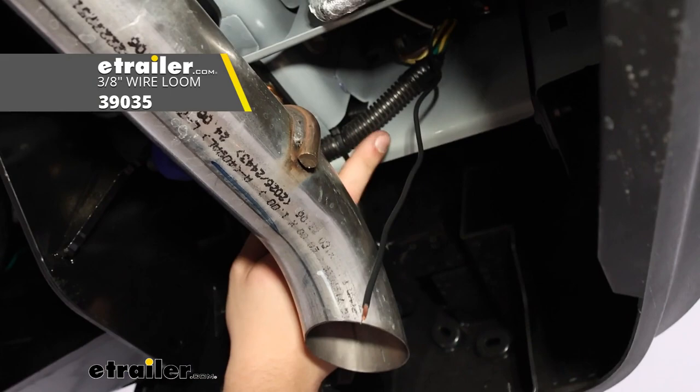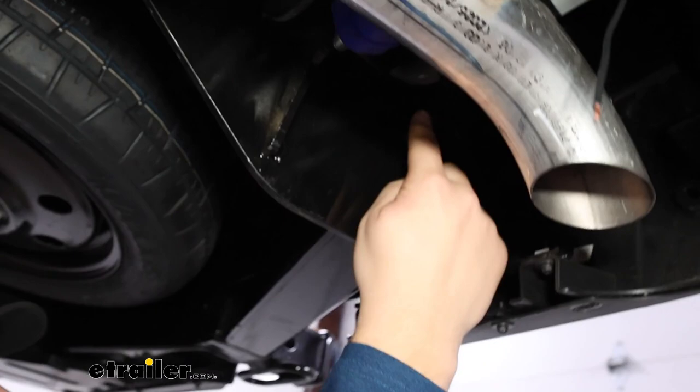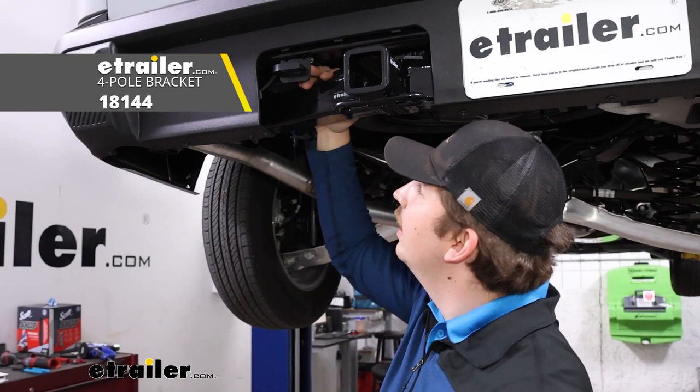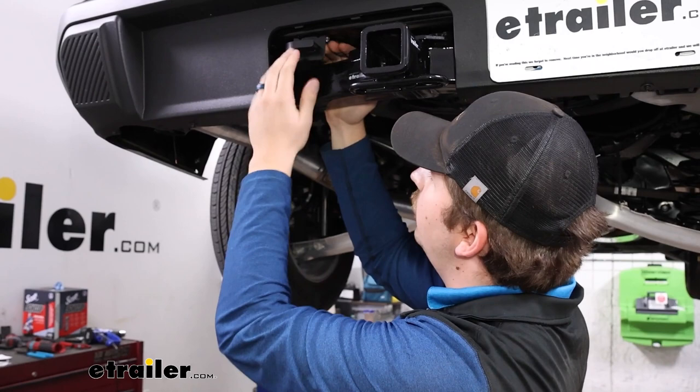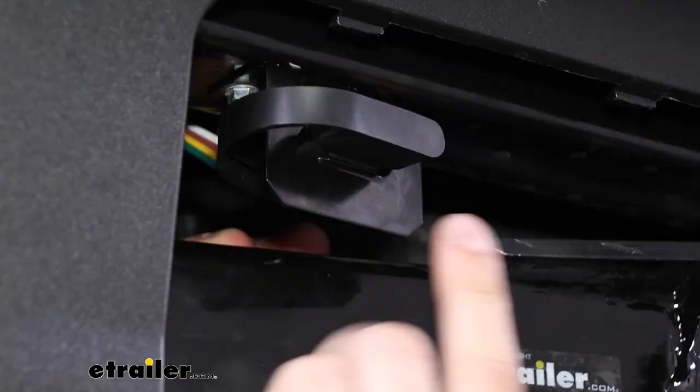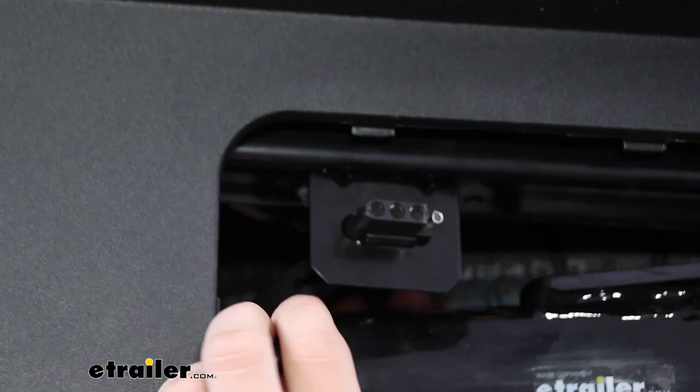For the four-pole wiring, we wrapped it up in some wire loom along with that green wire we routed earlier. It comes straight down following the same path as the green wire, all the way until you get right next to the hitch. You can see our excess is all tied up, and it leads to this bracket. The bracket doesn't come with your kit — you can pick it up here at E-Trailer. I chose to mount it with some self-tapping screws into the piece right up here above the hitch, so now I've got easy access right here. There are no-drill bracket options if you'd prefer that. And remember — if you're going to use this dust cap, put that on before you feed this through the bracket because it is difficult to get back out.